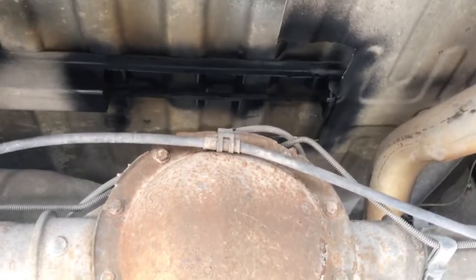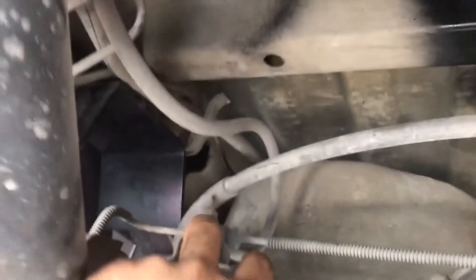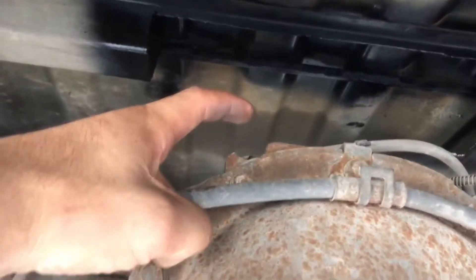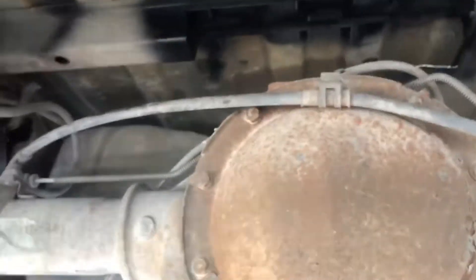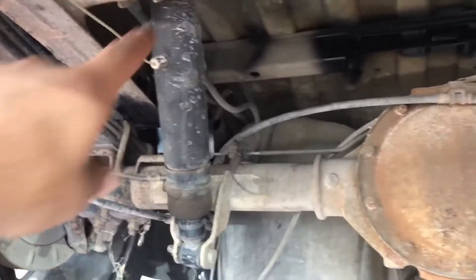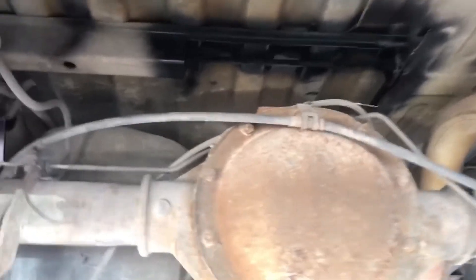My rule of thumb is if I do a C-notch, I'm also going to cut the bed cross brace, because most of the time there's a little separator bracket that bolts up and mounts all the way over here - and it always hits the bed. You do the C-notch and then the customer comes back saying it's bottoming out, and it's always hitting right there. So that's my rule of thumb: you do a C-notch, you do that too - all of them, it doesn't matter what year or what truck.